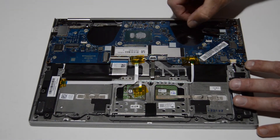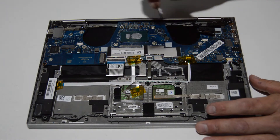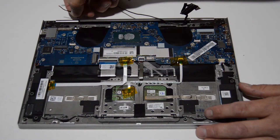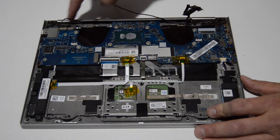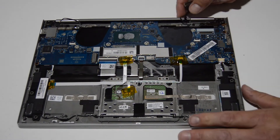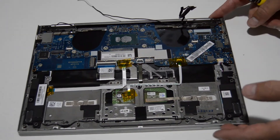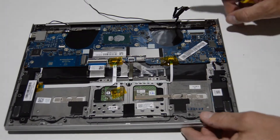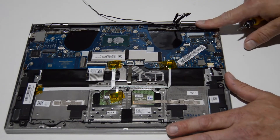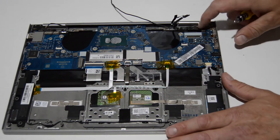Most laptops you can get away with it, and I think you can on this one too. If you pull the antenna from underneath the motherboard, it looks like you can. Once you have these cables disconnected from the motherboard, all you'll have to do is remove the hinge screws and then you can separate the display off of the palm rest. If you're replacing your display, it looks to be pretty easy. Just be sure the case is open before you disconnect the last screws on the display assembly, because the hinges are folded over the palm rest.